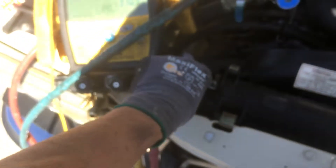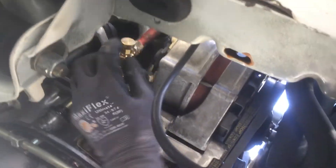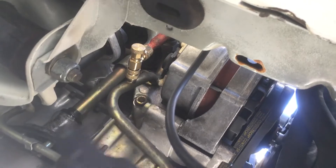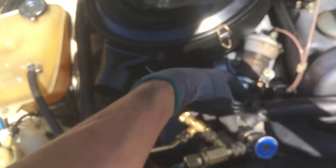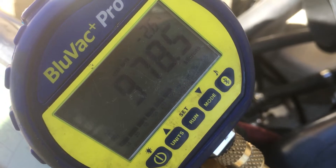I don't have time to hold this camera here all day and let you see how far it's going to go up, because I'm going to remove this out of the system and turn the vacuum up and take vacuum from both sides because I'm still looking for a leak. So let me open up over here on the low side. I'm going to open it up right here and you're going to see that go down — boom. Now you see it go down. I'm going to go back underneath and open the high side. I'm going to put it in the way it says open, and that's going to depress the valve core. We're now pulling back in from the high side and the low side simultaneously. I did inject UV dye into the system — I injected it into this low side hose, and this hose slopes down, so I know my UV dye went in here and went to the bottom of the hose. It's not being sucked back out. We're already down to 900 microns right now, and we are falling steadily.